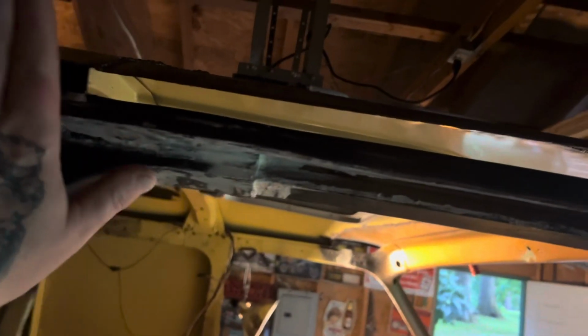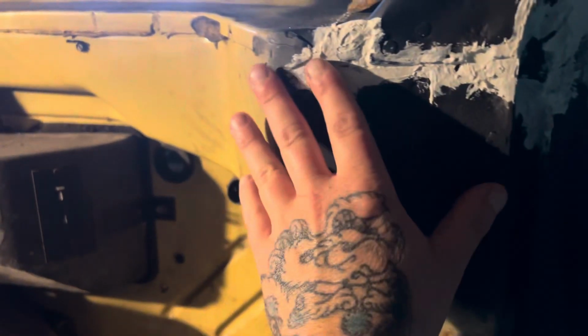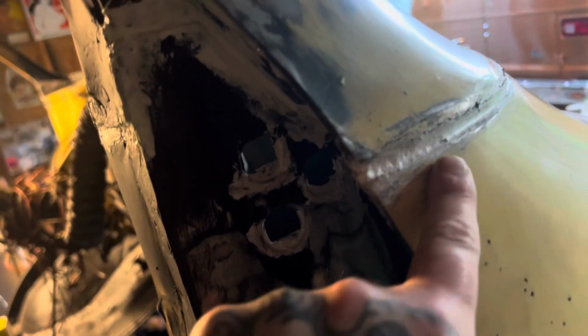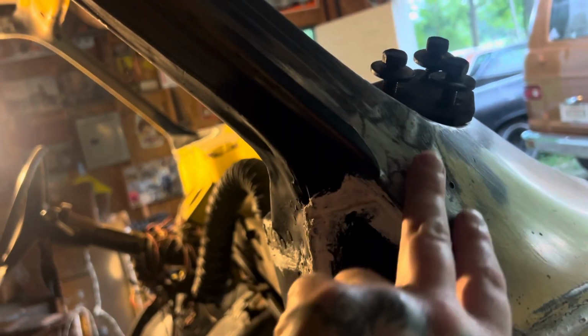And then I started repairing my panel to go over this and cross over onto the A-pillar. So the roof is in, the A-pillars are in. A-pillars are welded in, everything fit up real nice. Did some seam sealer work here, ground everything down. A-pillars are in all the way here, and they're welded in there and seam sealed there.